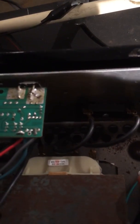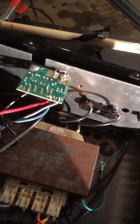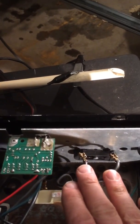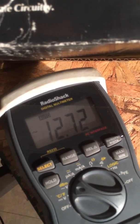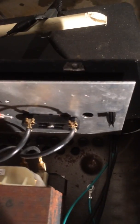Out of it comes your secondary. On your secondary, you have one lead — one of your main leads right here — which just comes through and comes back down, and either way that becomes your negative on your battery piece. The other two leads are right here. They're actually basically two different coils. They're both kicking out voltage, but it's AC voltage. If I switch over to AC and test it right now, I get 12.7, and then I test the other one — another 12.7. That's these two leads right here.